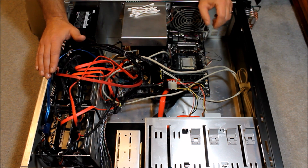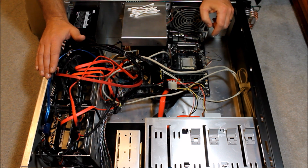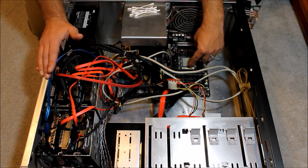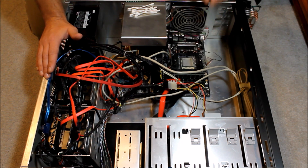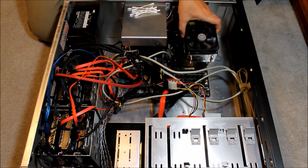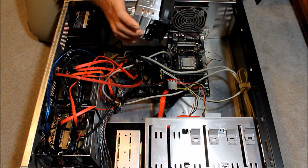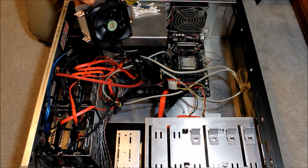I'm working with an AMD processor. Intel processors have a little different bracket around the outside. If you do need to replace a fan, you'll need to make sure you have a fan compatible with your particular type of computer. I'll put some resources in the description on how to determine what type of fan you need. These are called sockets, and the processor fits into a socket — AMD, Intel, and different versions all have different sockets. Generally you'll get a replacement fan; this is a universal fan that works for just about all AMD and Intel sockets, and it comes with various hardware to connect it depending on what type of socket you have.